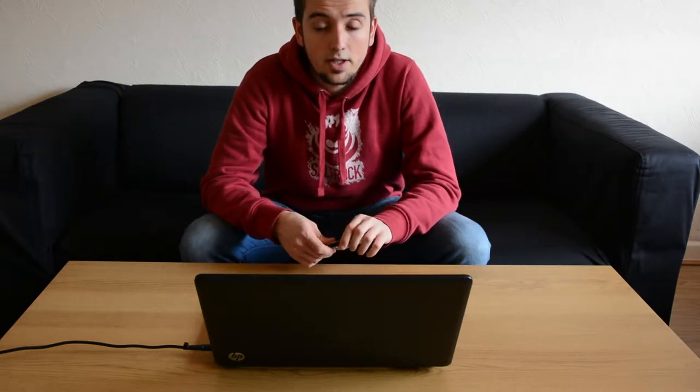I'm not too certain what the issue is exactly, however I do have a few ideas that I'm going to try out. My game plan is to try and boot it up, and in the time before it shuts down I'll install a program to see what the CPU temperatures are and find out whether it's overheating or not. And if it is, I'll open it up and try to clean out the heatsink as well as replace the thermal paste.